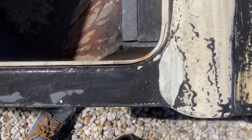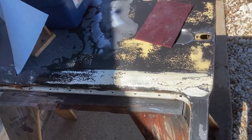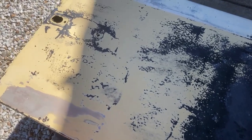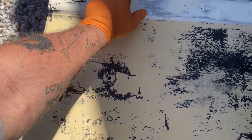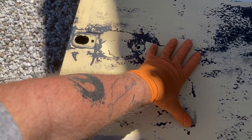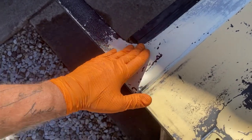So far, not horrible. We'll likely need some touch-up but it is starting to come off. Making some progress — overall pretty happy. Clearly it was a two-tone white and creamy yellow. There's a good chance I'll have to do some white touch-up, but it'll still be easier to get this to a nice surface, put a little gray primer down, then put the orange over the top, and then paint some white on white — thin coat — just to even it out. There's a big chip here, a hard lip right there.